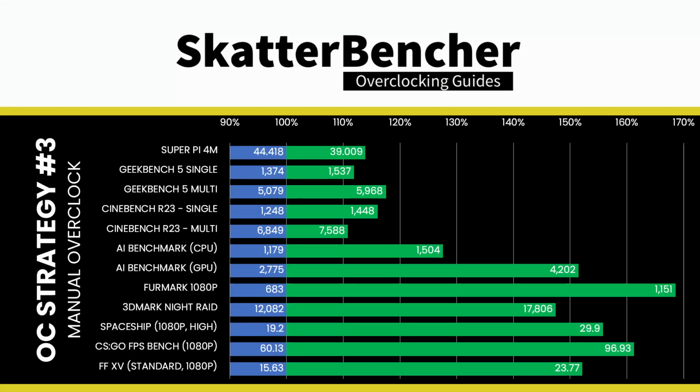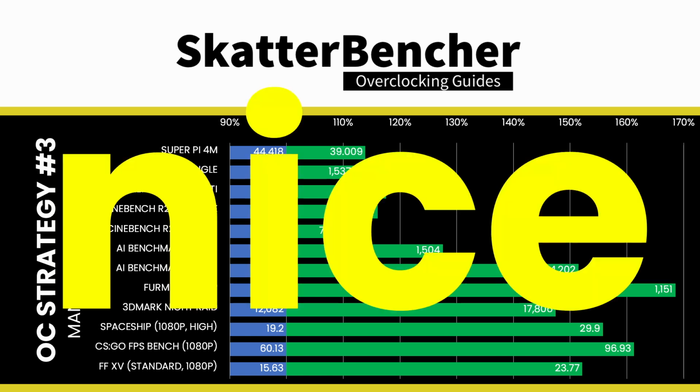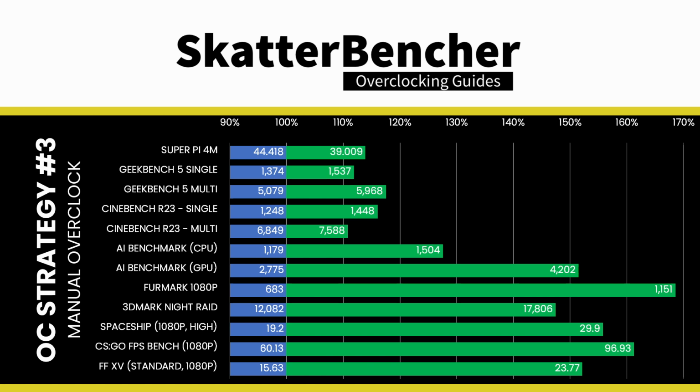We reran the benchmarks and checked the performance increase compared to the default operation. Our manual overclock of 4500 MHz is higher than the maximum precision boost overdrive frequency of 4450 MHz. Hence, we see a performance uplift in all CPU benchmarks. Furthermore, the integrated graphics frequency increase from 2000 MHz to 2450 MHz provides a lot more performance in 3D benchmarks as well. We get the highest performance increase of plus 69% in Furmark 1080p.